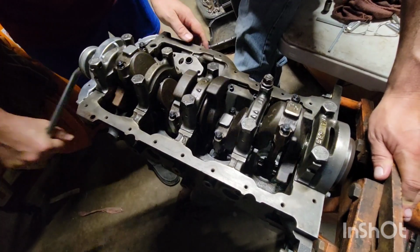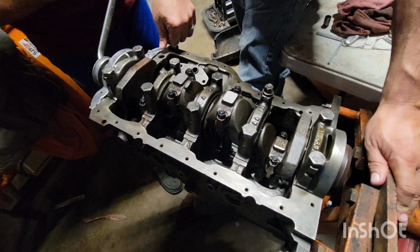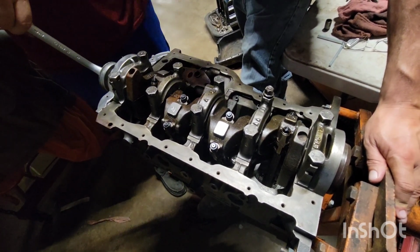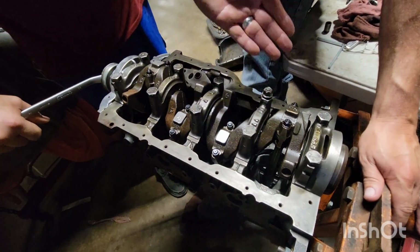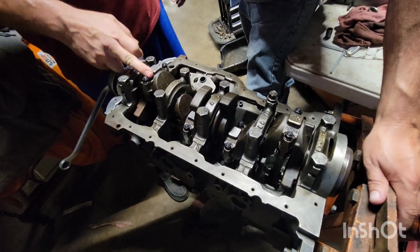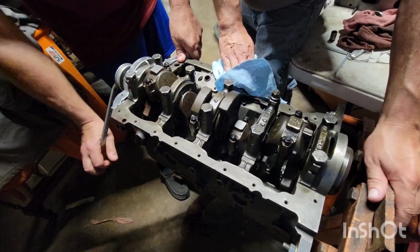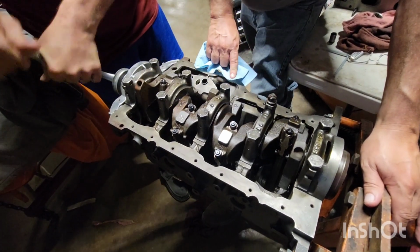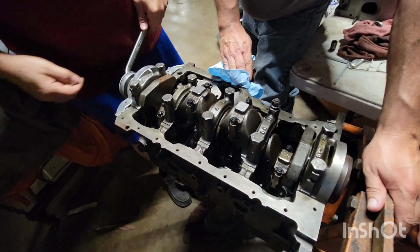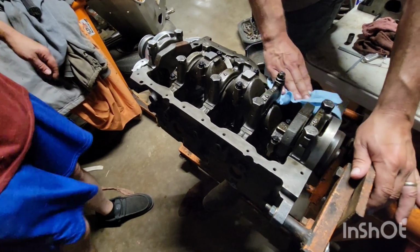There, that's where it's easy, but then when the pistons start coming back down and back up, it gets a little tougher, and right there it gets a little harder because of piston ring drag, because it's a 180-degree motor, I guess you call it. Two throws are here and two throws are down there. That's why these motors do what they do. All right, that's good enough. It'll do what we're wanting.